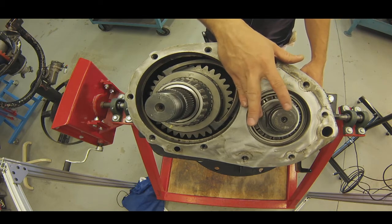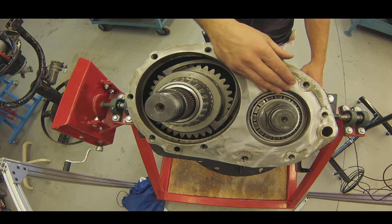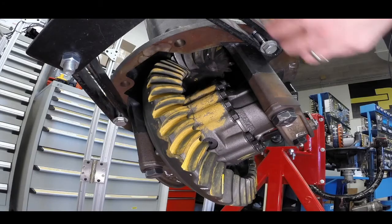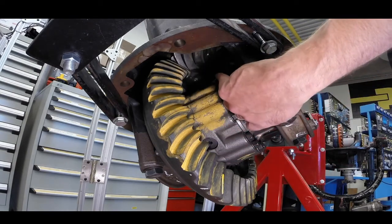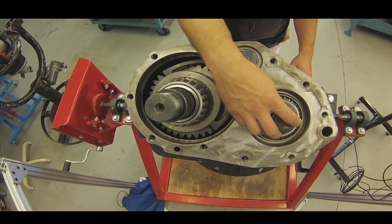On this integral unit, every time you need to change the pinion depth or make an adjustment because face and flank contact is incorrect, you'd actually have to remove the bevel gear — pull the entire differential case and bevel gear out from the covers — so you can then press the pinion out after you've removed the large nut on top.